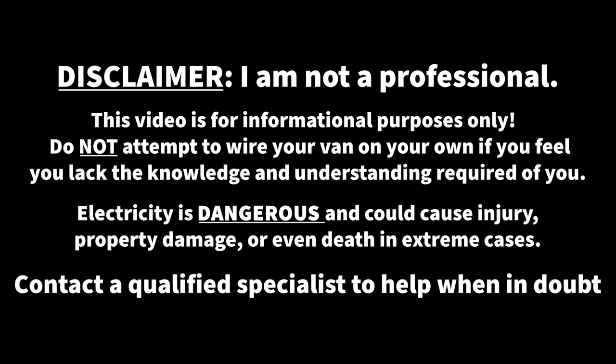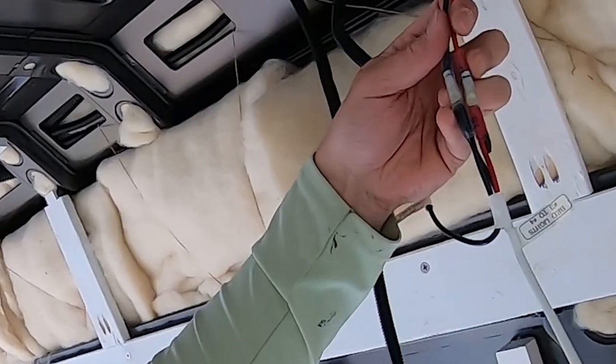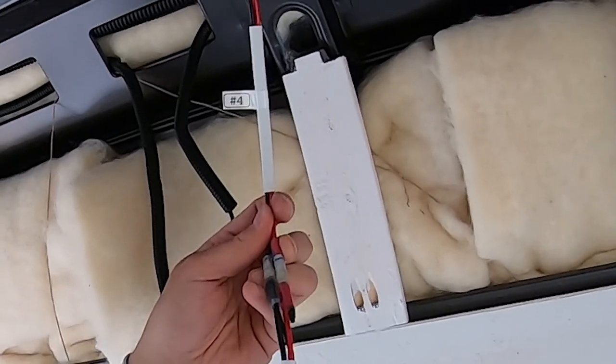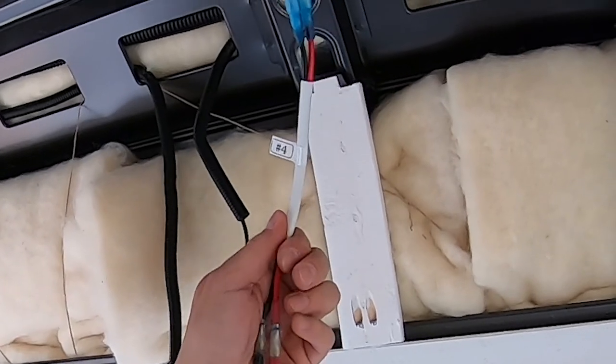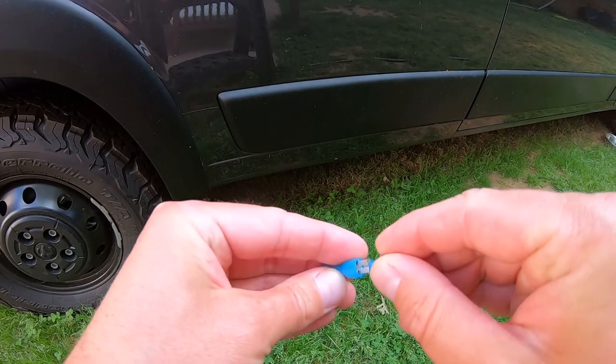The following steps are applicable to any wire connectors you'd be using in a 12-volt system. The options I chose are not necessarily the only options, but I felt they were best for my system. I use ring connectors to connect to the fuse box, butt or step-down connectors to daisy chain lengths of wire within the LED light runs, and spade connectors to connect the wires to lights and switches.